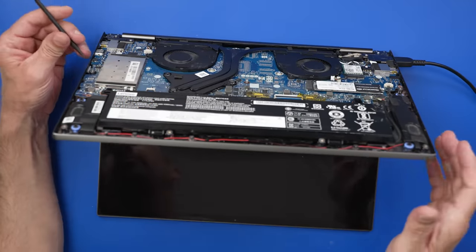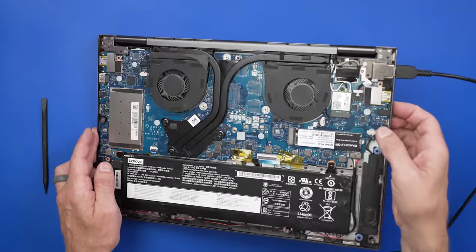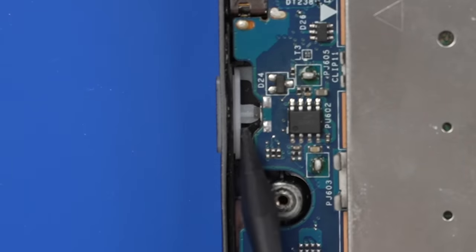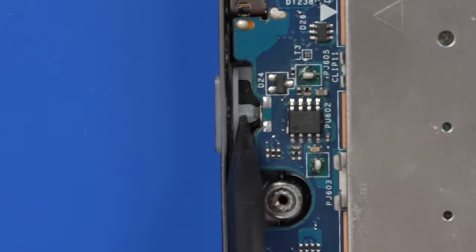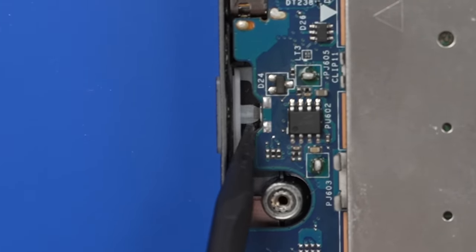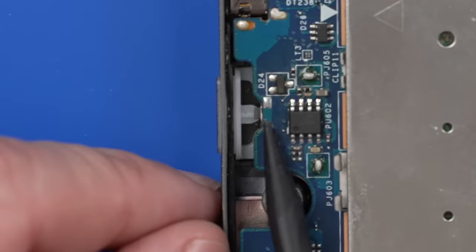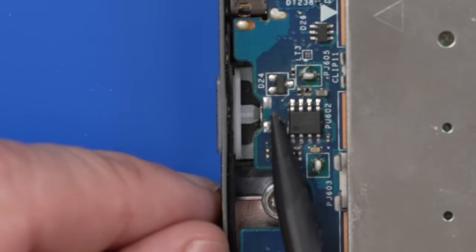Plugging it in to power — and we're getting nothing. We do have a charge light over here, so that's good news. It may need to charge the battery up a little bit, so I'll let it charge for a bit and then we'll try it again. As I was reassembling this, I noticed that the actual power button here — and the plastic piece that sticks out that's supposed to hit against the power button on the board — it's actually kind of underneath this power button. This tells me that power button is actually the wrong one for this board. The shop that had it before actually replaced the power button with this one, but this is the wrong part. That would also explain why the button, while it looks like it fits correctly, doesn't actually fit all the way and connect to that back pad.